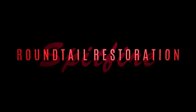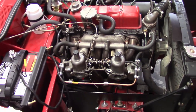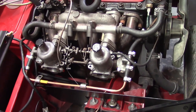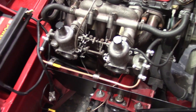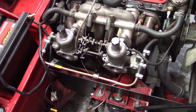Welcome back to carburetor tuning part two. In the interest of full disclosure, I had not intended to make this a two-part video. However, I'm having problems getting a low idle. When I redid the throttle discs and replaced the spindles, I didn't really pay particular attention to how the throttle discs landed when they were shut inside the throttle body. Idling at 1000-1200 RPMs when the workshop manual calls for half of that is not going to work.